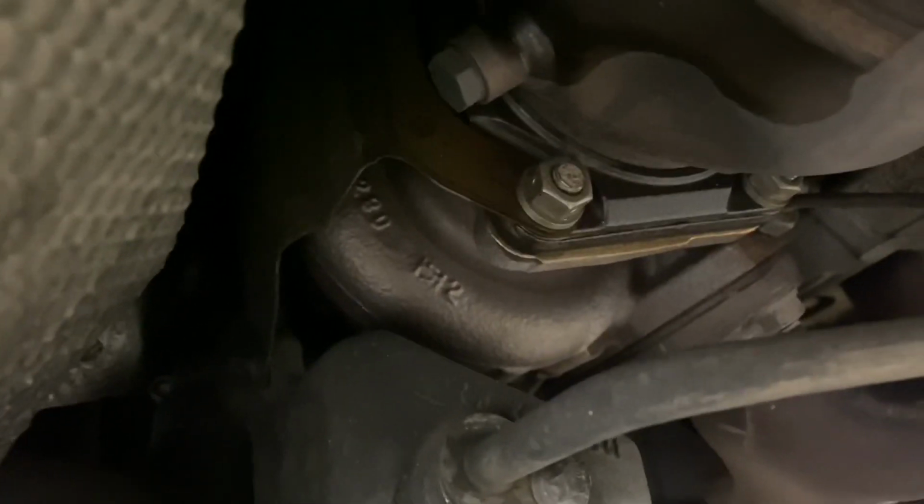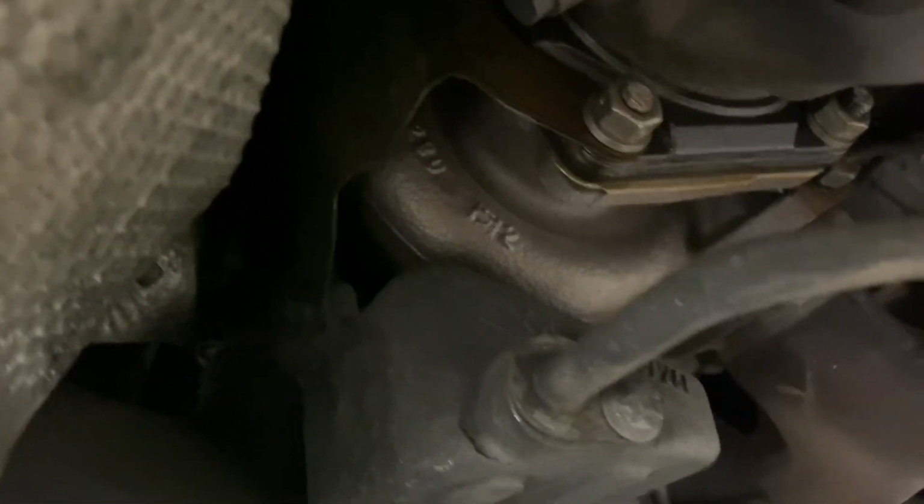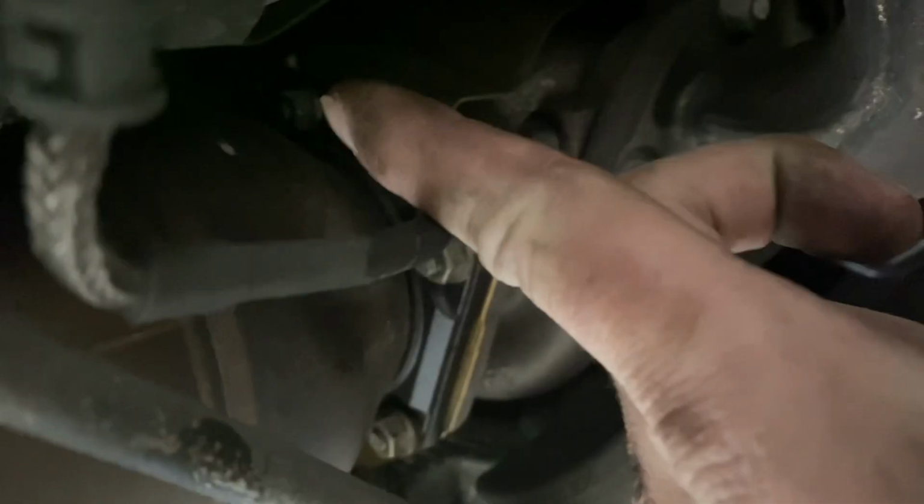And then these are the bolts I was talking about off the turbo. There's essentially 4 studs out of each turbo. And these look like they may be interesting to access. You can see that top one right up there, but I pre-soaked those in WD-40, so we'll see how quickly I get this apart. I'm gonna go ahead and unbolt these first, and then I'll do the brackets.